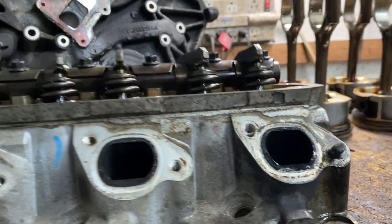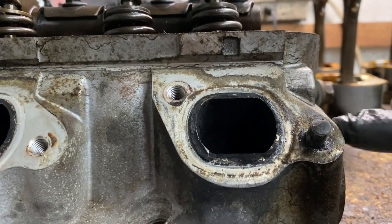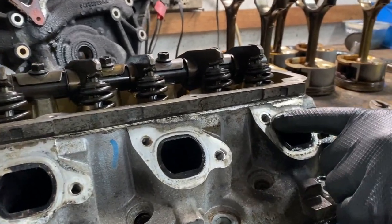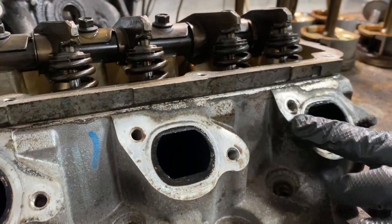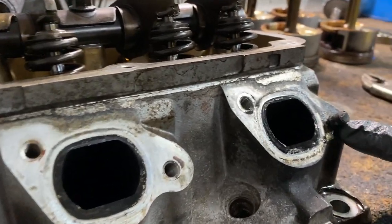Today's video I'm going to have a quick tip on how to remove a broken stud in an aluminum head. There's a couple of ways you could do it. If you can grab the meat of it that's one way, but if it's flush or further in, you're going to need something called an easy out. You'll have to drill it and use an easy out — I'm going to show that in another video because I do have another one that's broken, but this one is a little bit different.